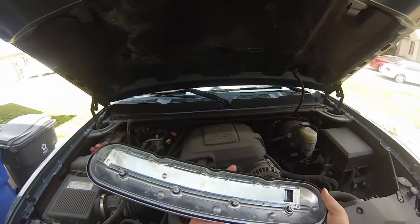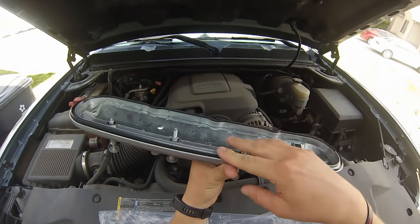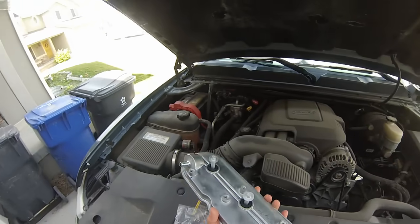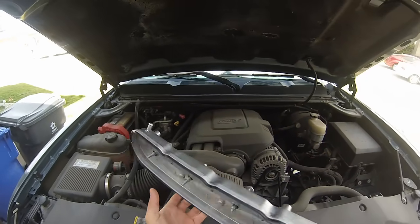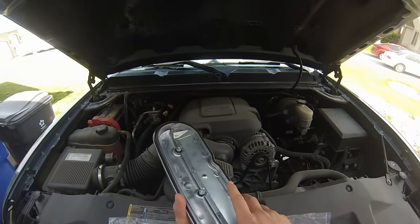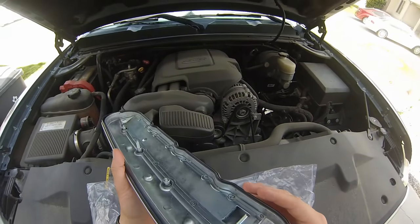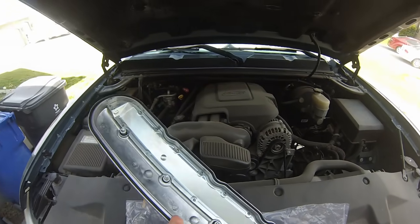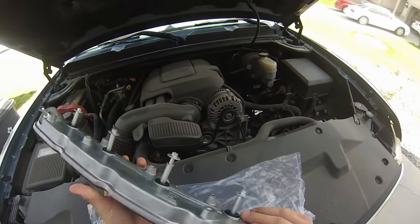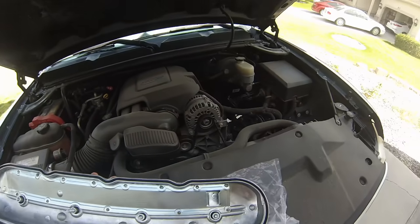And when you order up this new one, make sure it comes with a new gasket right here. So you don't want to reuse old gaskets. The other thing, and this is straight from the factory manual, they want you to put some water right in this hole here and make sure that it doesn't leak anywhere. So you want to make sure you're not getting unnecessary leaks around this fitting here or anything else. If you are getting leaks, then you need to seal it with epoxy.